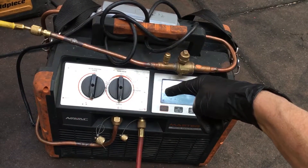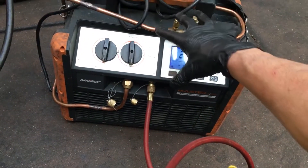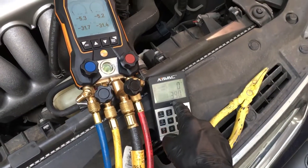I just finished the recovery procedure and I have it in the purge mode. I'm finished removing all the refrigerant. It's now in the container, it's on the scale — 390 grams.